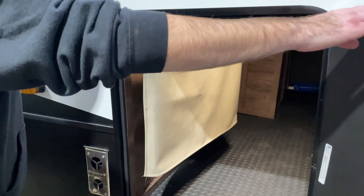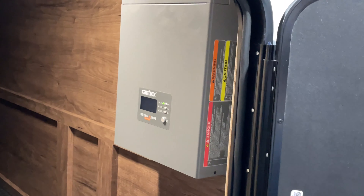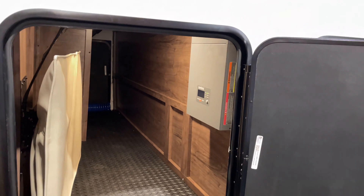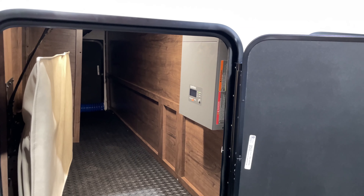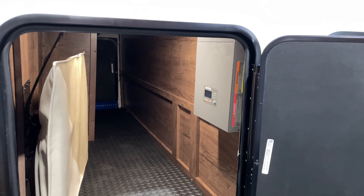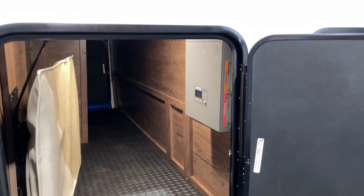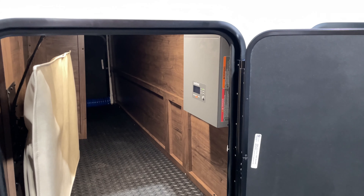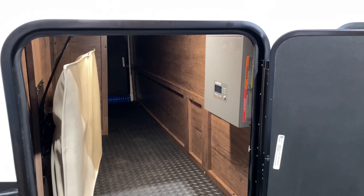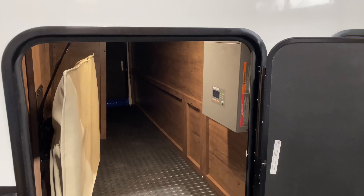In the next compartment you have a motion-activated light inside the storage compartment, and your inverter. It is a passive pass-through power inverter, so you don't have to worry about two power sources doing damage to your electrical. The inverter takes power from your battery and turns it into 120-volt house power so you can use outlets. This inverter will run your refrigerator, your televisions, and a couple outlets in each room — so it does quite a bit. If you're going to be running on inverter power a lot, I would recommend a two-battery setup, because it has a significant draw on the battery.